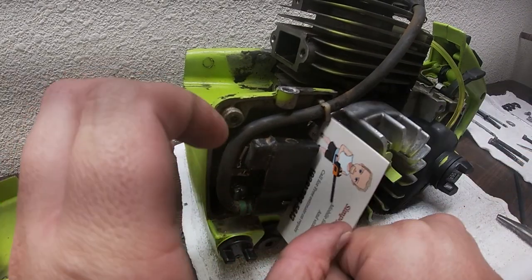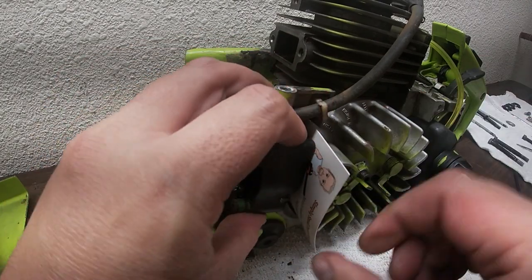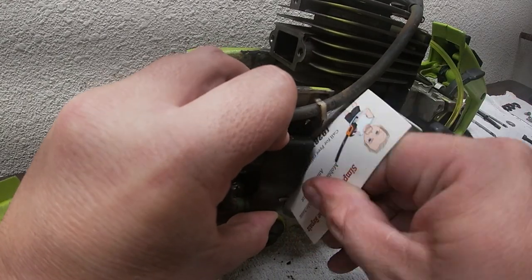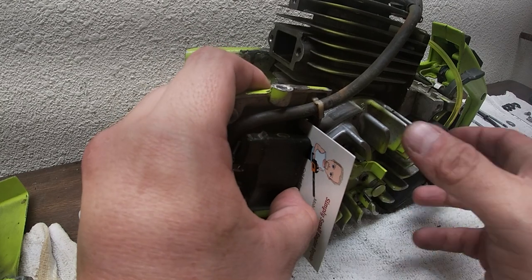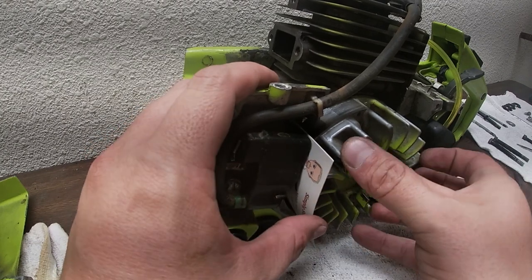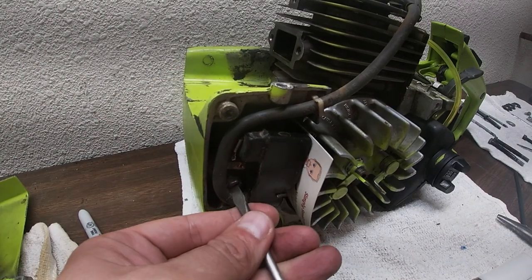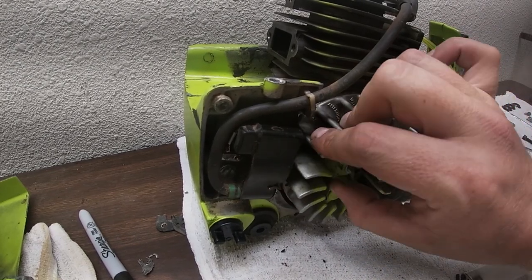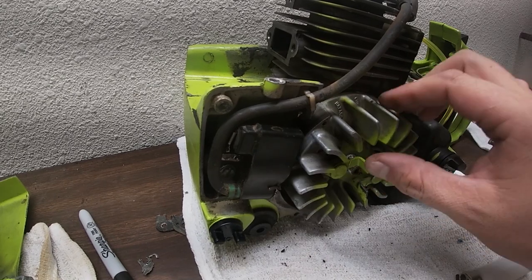Okay, now that I found the bolts, you take a business card or your actual feeler gauge, you line up the magnets. And you should hear it, you know, clink together like that. But you want to put the spacer in there to make sure you get that right space for your spark. And this is before you tighten them all down. So there we go. Now bring it down, let it click on. Now tighten in your bolts. And you should have a nice space in between that. Matter of fact, you could hear it clicking. Okay, perfect.